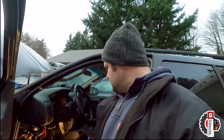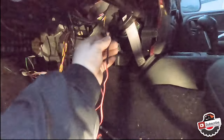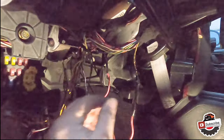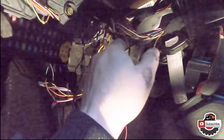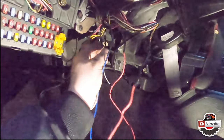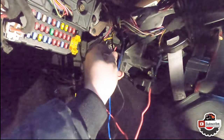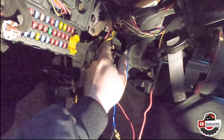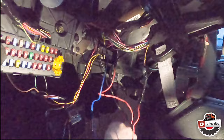I removed the alarm and disconnected most of it. This is a terrible wiring job. What they did was clip the signal wire — this one looks like it's for the PCM, a connection wire to power on the PCM once you turn the ignition on, to give it a signal to get ready. And these wires here were for the ignition signal — to send a signal to the ignition to get ready and start working. I connected those signal wires back.